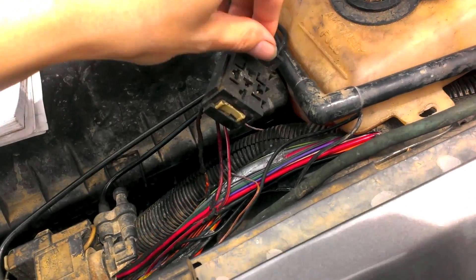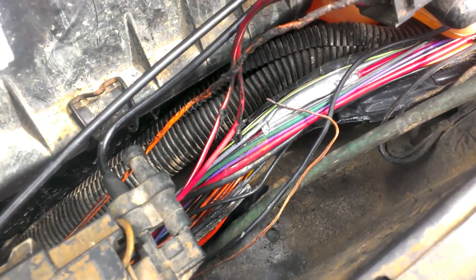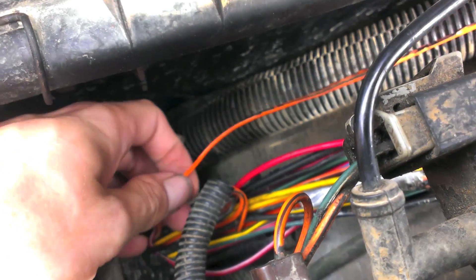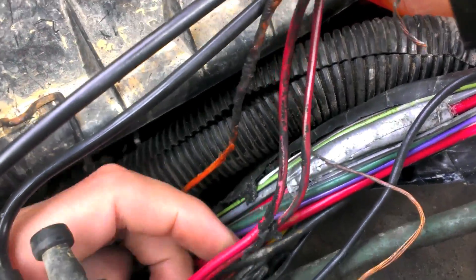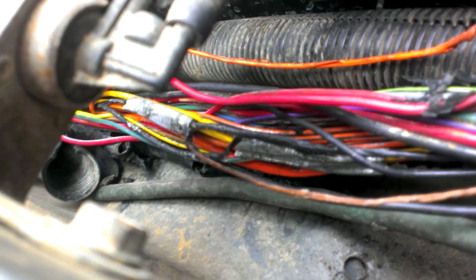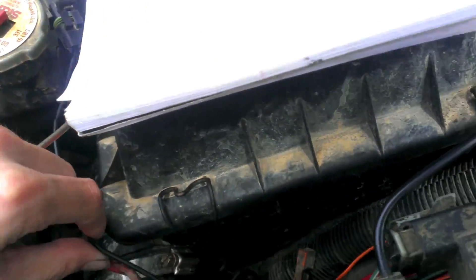Here we are in the daytime — here's the whole fan connector relay. I've traced back all the wires and opened up the wiring harness. I think the wires were old and overheated or shorted, because this section doesn't look pretty. Further down the harness it looks fine, but you can see bare copper here. The ground wire was melted all the way back to the splice. The fan ground runs through the harness to a ground point and tests good.